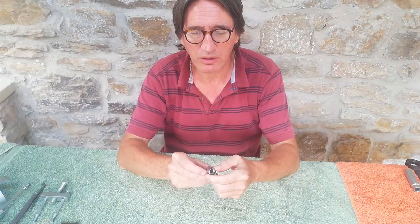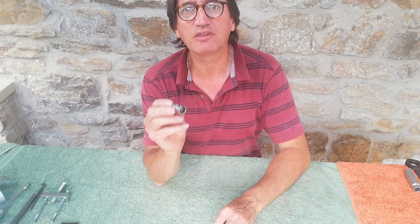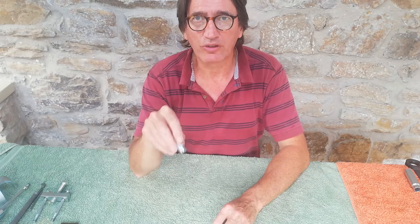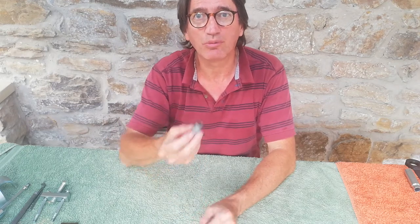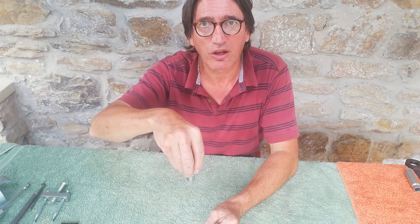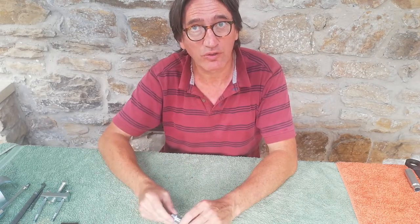This is a quarter-inch Whitworth socket — but what's special about it is that it's a specially thin socket which goes down inside the cylinder head. There are three nuts in the top of the cylinder that are really hard to get to, especially the central nut at the front. A normal socket is simply too wide. This one is just thin enough to slot down and undo that nut. You can order it from a Norton specialist — ask for the special quarter Whitworth socket that will fit down to undo the central nut in the top of the cylinder.